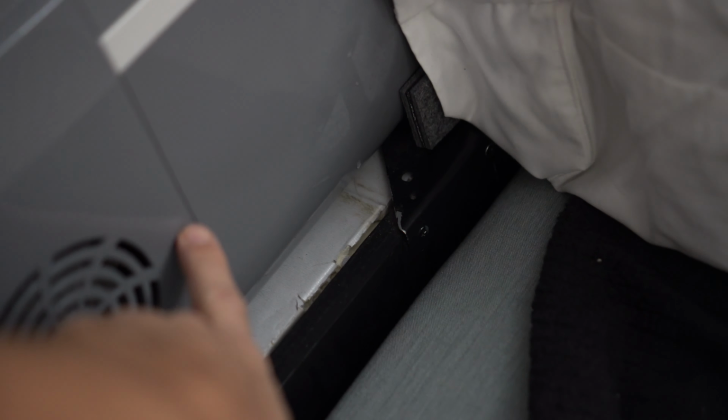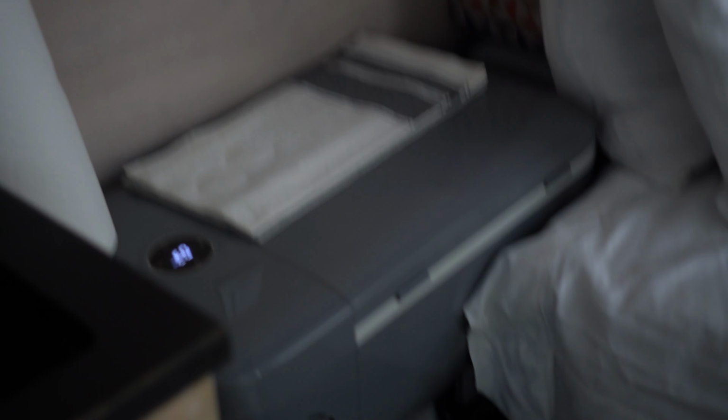And every morning I wake up to this condensation. It doesn't happen where it's not cold. A lot like how the inside of the van wall is going to be. How can I prevent that? If that kept forming and forming and forming, dripping down into there, that's your van wall forming in there and it's staying in there. You're going to get mold.